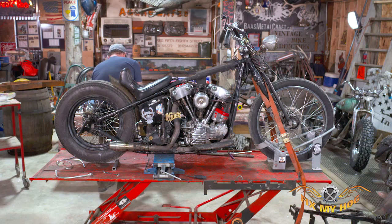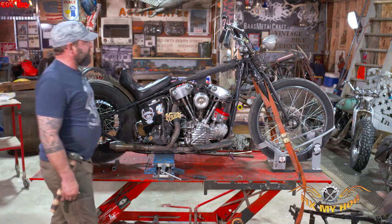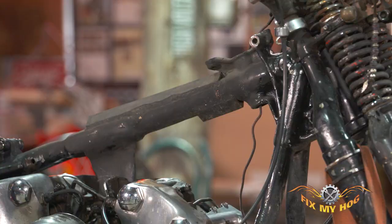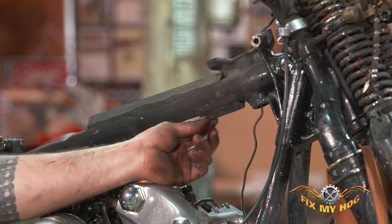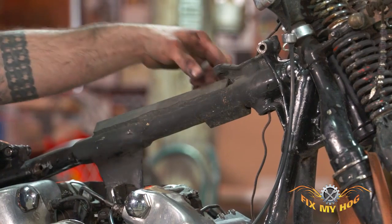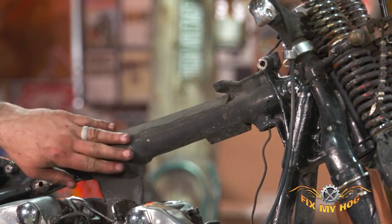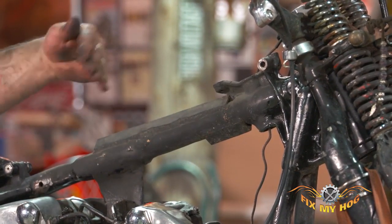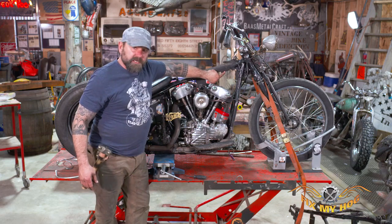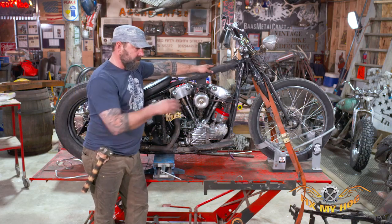Organization is key. The more organized you are the easier the process will be. Now that we have the gas tank off, this allows us a better visual look at what was under here. I knew right away I saw this piece of angle iron, which showed me there must have been a crack or some structural problem with this frame. Now looking at the top with the tank off, I can see there's another piece that's been welded all the way along the top — so this whole top backbone is pretty much junk. It would need to be cut out and replaced. This is just a band-aid repair; you wouldn't want to leave that forever. I'm glad I took the tank off. We're going to replace this with a new frame.